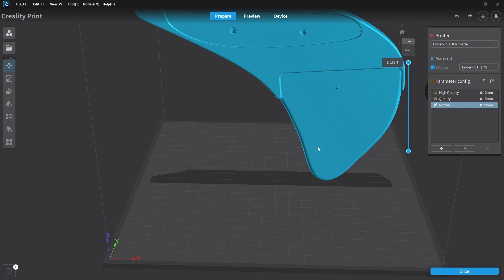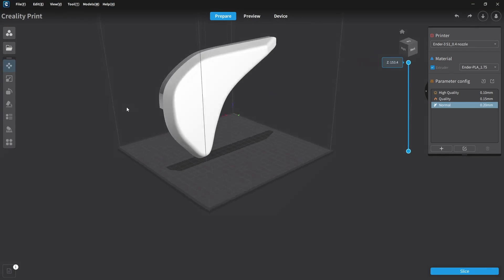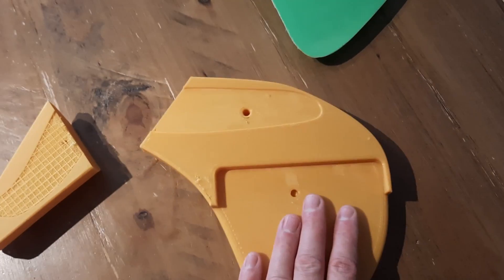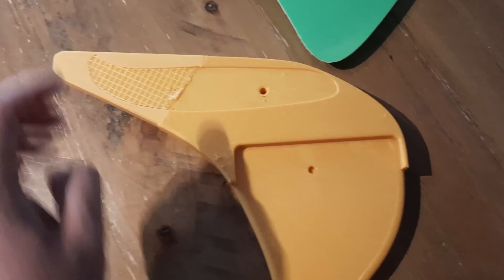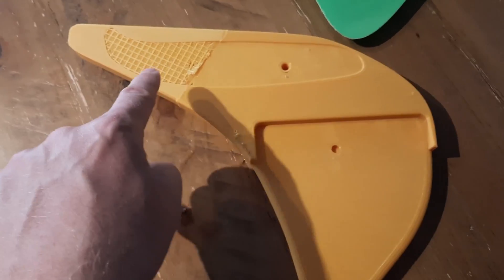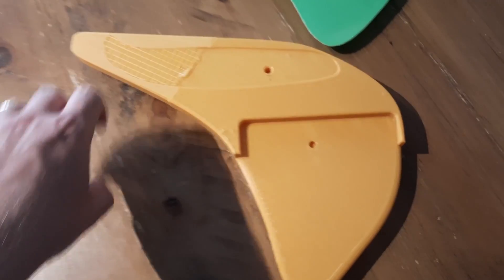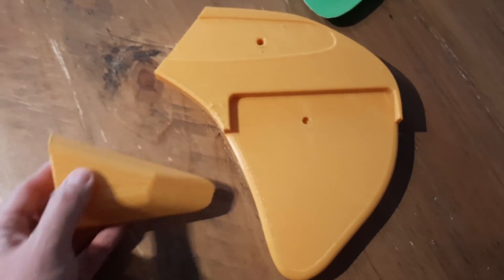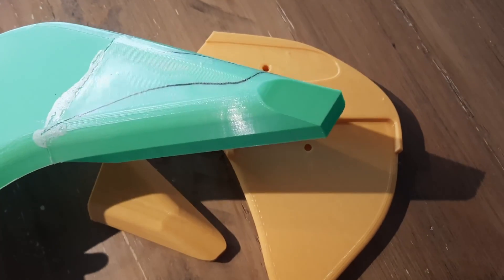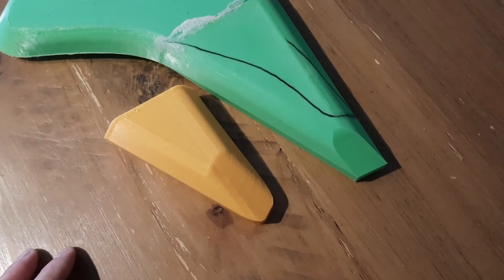Here it is modelled up — you can see those three fastener holes and I've spent hours perfecting the shape and surfaces to make it look as OEM as possible. Here's the printed part for the left hand side of the spoiler; I haven't quite finished weeding out all the build supports from the 3D printer but it gives you an idea. It's a slightly more refined part with a nice trailing edge which looks a lot less slabby than before, and a quick side by side of those two bits — I hope you'll agree that looks a lot nicer as a finished part.